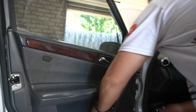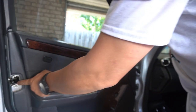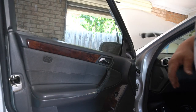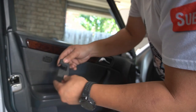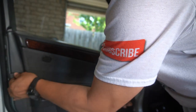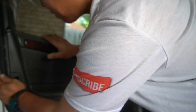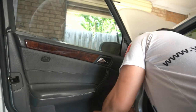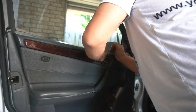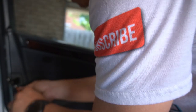Push it back until it clears it all. Now everything else should line up. Reattach everything — start with this piece: put it in before pushing the door panel back. The screw hole is here, so it sits this way. Push it straight in, push it down, then push it up. Clip it back in, make sure the screw hole lines up, then clip the door back together — just push it all in so it clips back. Now we can put this T20 screw back in.